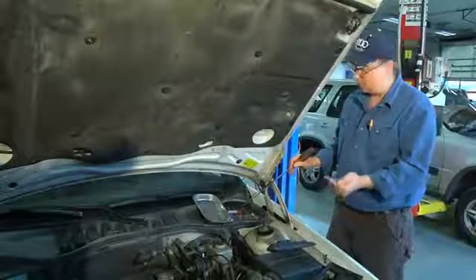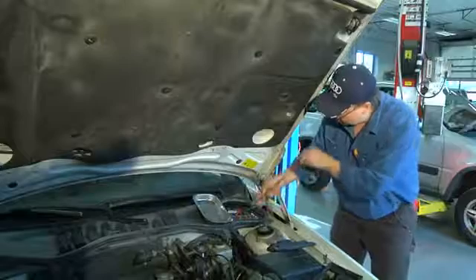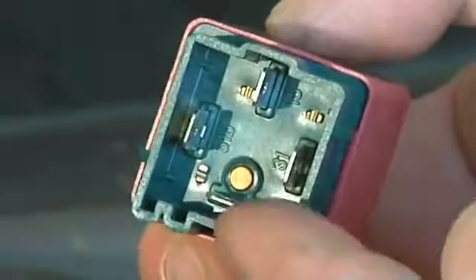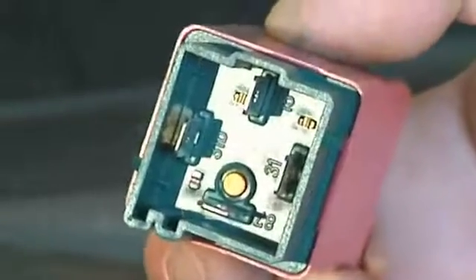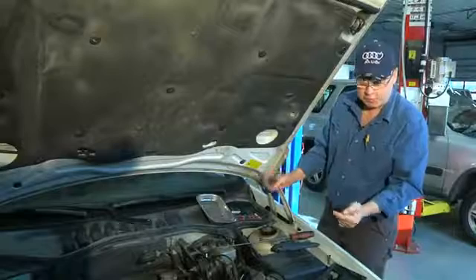The second wire that comes from the pump is the ground circuit. Our job today is to test this pink wire from the relay to the back of the car. When I pull the relay out of the car, I'm going to look for pin number 87. The pins are numbered on the bottom of most if not all relays. When I find pin 87, I'm going to stick my ohms probe in the pink wire and then the other probe in the back of the car to check the resistance in this wire.